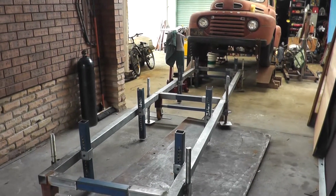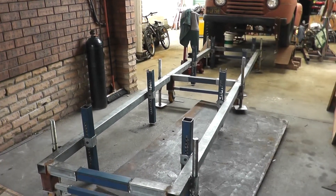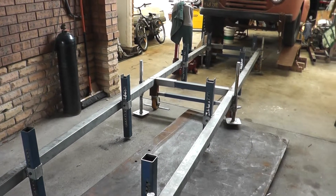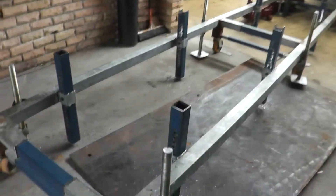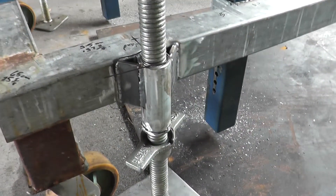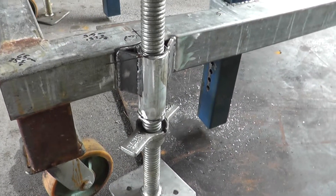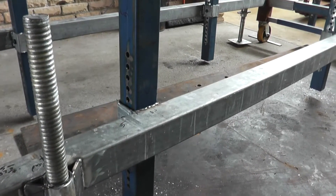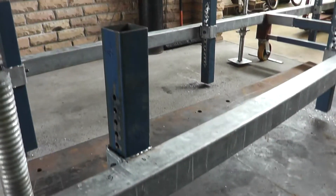Here's an update on the chassis jig — looks like it's finished finally, and it'll be going under the truck soon today. I've built these screw jacks from scaffolding; they will raise the frame. The wheels are just to make it easy to move around, and I've got adjustable stands.